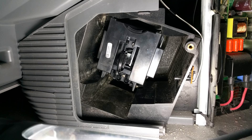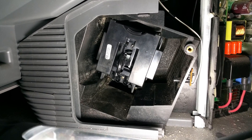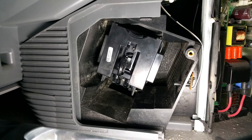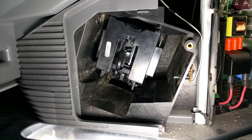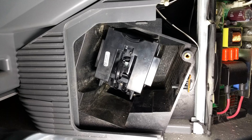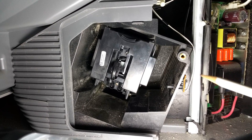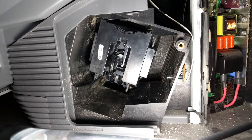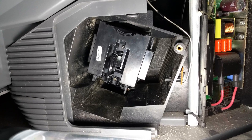One of the YouTube videos fixed this situation by putting a piece of wood on the front of the bulb housing. It would fix theirs, and I did the same thing here — didn't fix mine. The reason is both of these micro switches, if either one is defective or not being picked, it will cause that symptom.